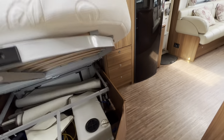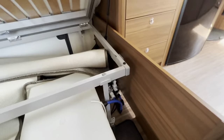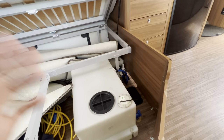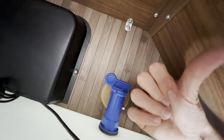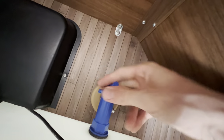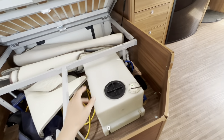Underneath, if you lift it up, you put your carpets. This is your onboard water tank. To drain this off when not using the caravan, all you need to do is open this tap here — it says closed, this end wants to be pointing in towards the caravan — and that's emptying the onboard water tank. You want to do that especially when storing the caravan in the winter, as you wouldn't want any water to freeze in this tank.